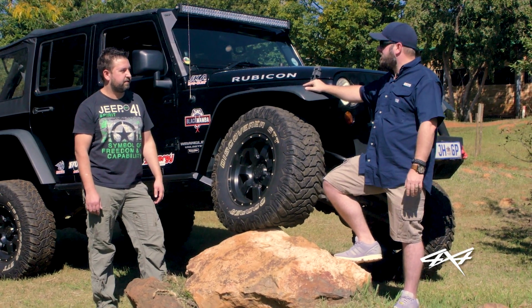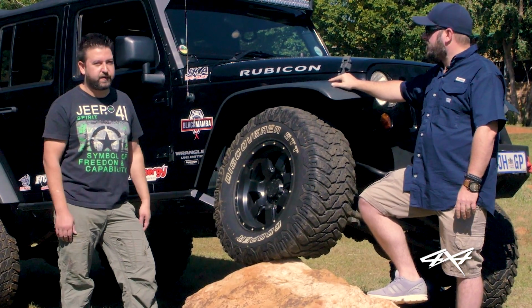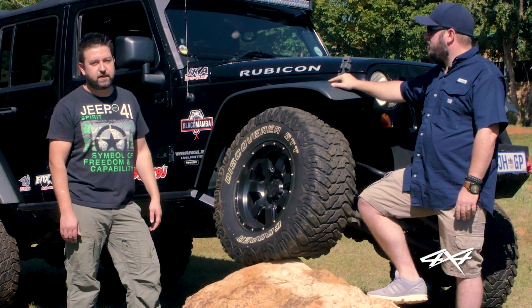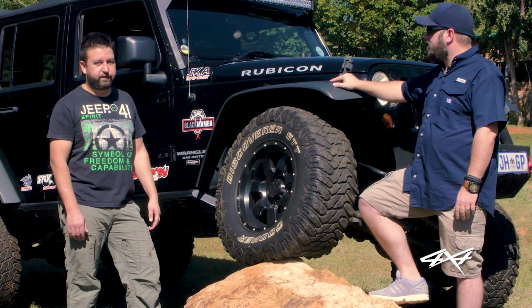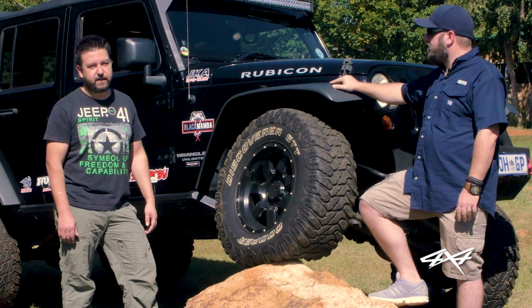I've noticed the same, a decrease in power. I've got about a 10% decrease in power, I would say. And then normally you have to balance that out with gearing. So if you go up one or two sizes bigger, it's not really the end of the world. But if you make a massive difference, you'll have to look at re-gearing your axles, which is a costly exercise.